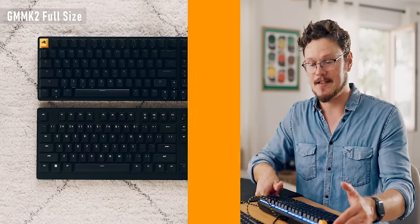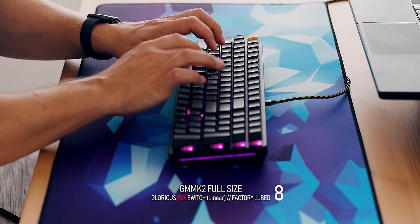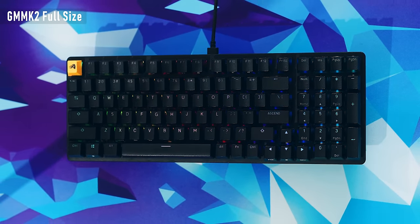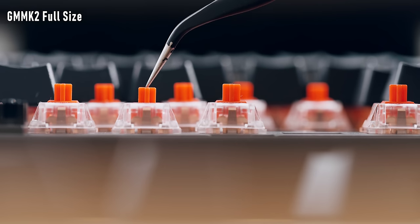It's awesome for compact spaces while still letting you numpad away. The base is super heavy which gives you good stability. The switches and stabs are pre-lubed by Glorious, which makes this one of the nicest keyboards to use on a daily basis. The double-shot PBT keycaps have a good amount of texture but the legends are fairly soft, indicating a less premium keycap. The GMMK2 is hot-swappable with three and five pin switches. The Fox switches feel really smooth but perhaps a bit closer to blacks than reds especially when you bottom out. This would be 100% my top pick for a full-size keyboard. Well done, Glorious.